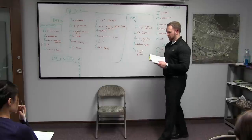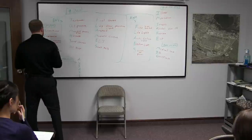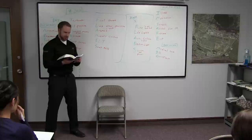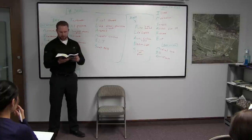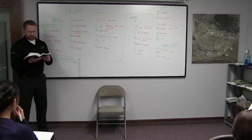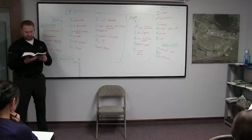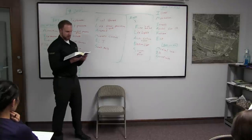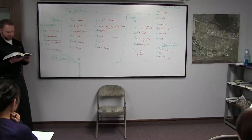91.213 talks about inoperative instruments and equipment. This goes into the minimum equipment list. And here it gives the definition. The aircraft has within it a letter of authorization issued by the FAA Flight Standards District Office having jurisdiction over the area in which the operator is located, authorizing operation of the aircraft under the minimum equipment list. The letter of authorization may be obtained by a written request of the airworthiness certificate holder. The minimum equipment list and the letter of authorization constitute a supplemental type certificate of the aircraft.